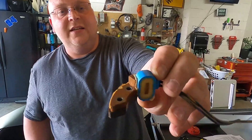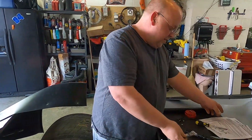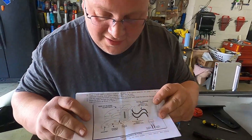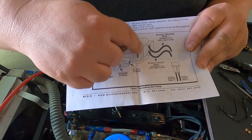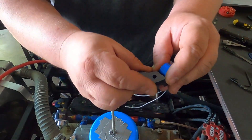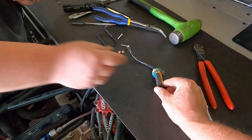Out with the old - here's old nasty. Looks like some window silicone they used in there. We're going to reinstall ours with some ultra black gasket maker. A couple things when you put these on - just reading straight off the instructions for those who don't want to read them. You gotta make sure the orange stripe faces towards the reluctor wheel and the black stripe faces towards the magnetic pickup. So there's the orange stripe facing that way, and the black facing towards there. We're going to put a bead of silicone across the back, same as what they did.